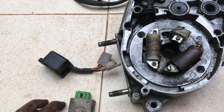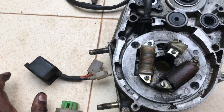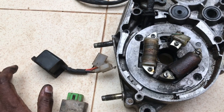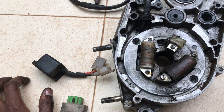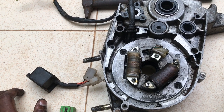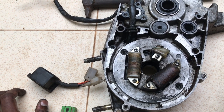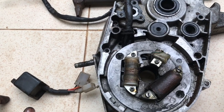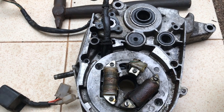You don't need to change the indicator holders, but for the headlight, if the new bulb doesn't fit the old holder shape, you can change the holder — though some 12 volt bulbs do come in the old holder shape. You also need a 12 volt horn and a 12 volt flasher unit. Once all of these are changed, your bike will be a full 12 volt system.